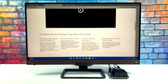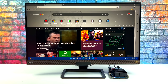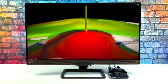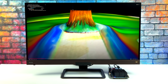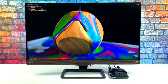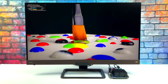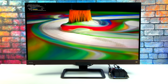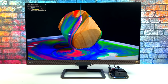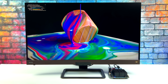I'm really glad to see that Hardkernel did their research on this CPU — it's set up really well out of the box. A lot of mini PCs and SBCs with this Celeron chip don't boost as high because the TDP is set too low. Hardkernel definitely did some tweaking in the BIOS and got this thing working very well. With scaling completely off in Windows 11, we've got a 4K 60fps video streaming from YouTube. On the initial load-in we had 13 dropped frames, which is pretty normal. The video played all the way through with only those 13 drops — it can definitely handle 4K.